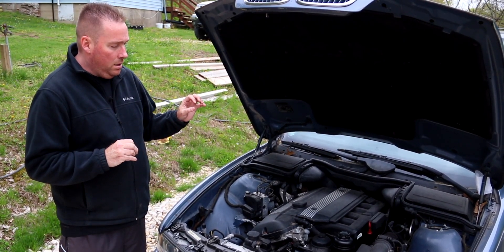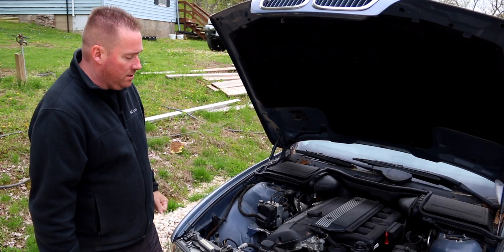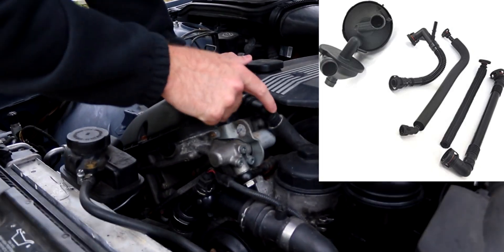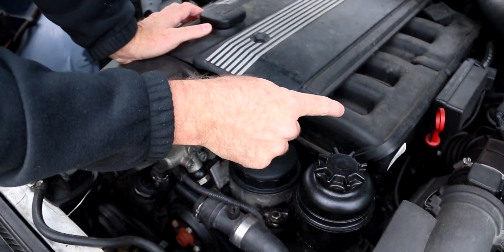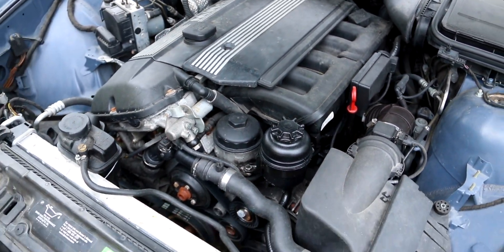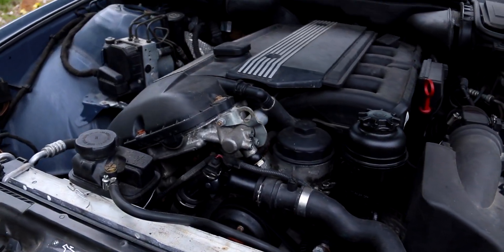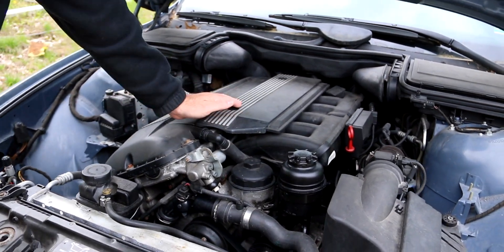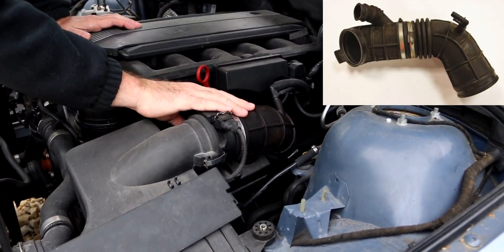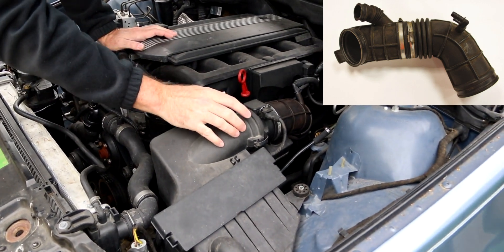That accounts for your running misfire, light misfire, or cold start misfire. A cold start misfire could be a coil pack, but it could also be the PCV — which runs off this tube here. This tube runs down under the intake to the PCV valve, or CCV on this car, and drains back into the dipstick tube while feeding vacuum. If that diaphragm is broken, or any of these pipes are cracked, you'll have all kinds of issues. Also, your throttle body boots up here are rubber and crack with age as they go down to the idle control valve, which can also cause a cold misfire.